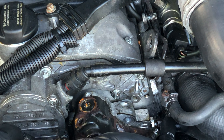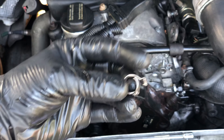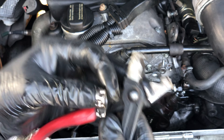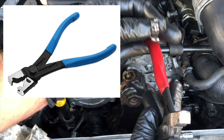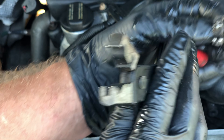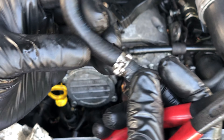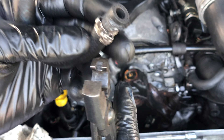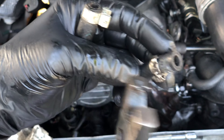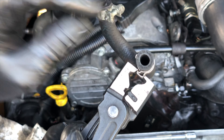With those three bolts and everything unhooked, your two elbows are still connected. If you've got the original clamps, it's going to take the click-C hose clamps — that's what Mercedes put on there originally. These are the pliers you need to open and reuse them. Notice the groove down underneath — the click-C hose clamp comes unhooked like this: put the little notch over the little nub and squeeze till it clicks.